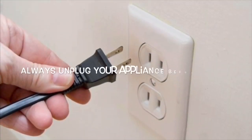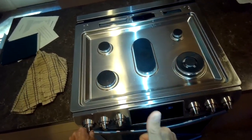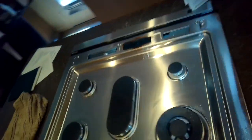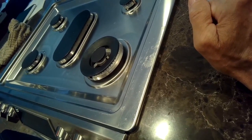We have a Samsung gas range where a couple of the burners aren't lighting - the front right and the back left. Most of them are clicking, and when I trigger one for clicking I'm looking at all of them to see if they're sparking. I notice that the back left and front right have no spark, while all the other ones you can see and hear a spark. That means the switches are working to create the spark, but there may be something wrong with either the igniter or the spark module.